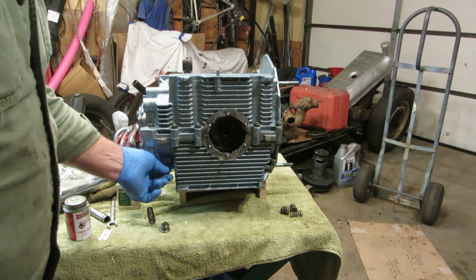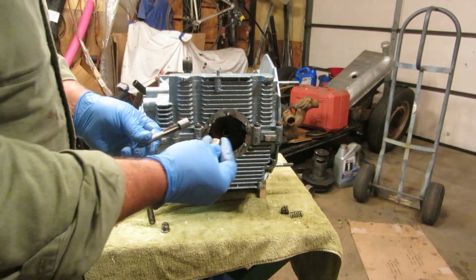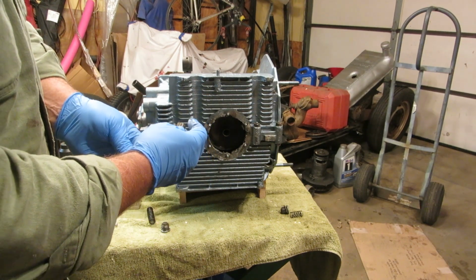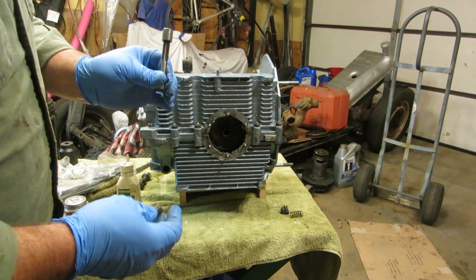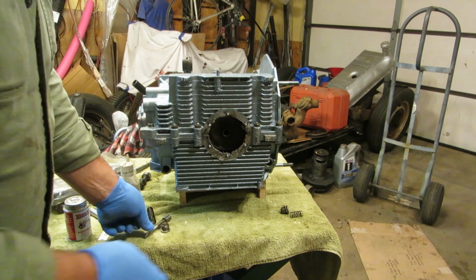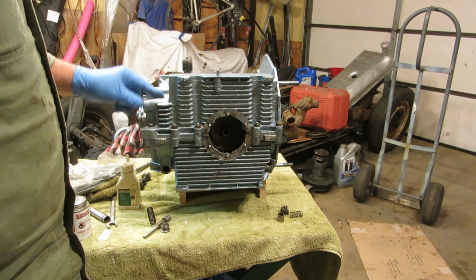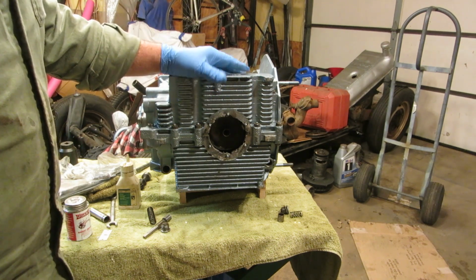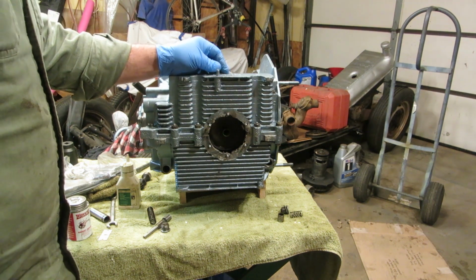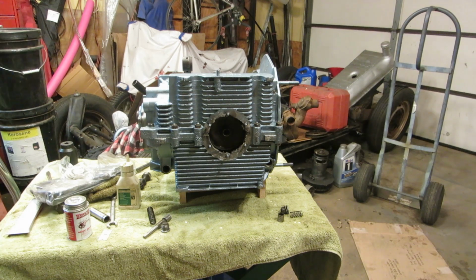This is a dual relief case, and dual relief cases have those kind of relief valves. If your relief valve in your dual relief case has a groove cut in it, it's a single relief valve, and it's meant for a single relief case. If your relief valves are not working properly, the oil pressure going to your oil cooler could cause a leak, because it will not regulate the pressure properly. So let's get those in there, and then we'll cover the sump gasket next.